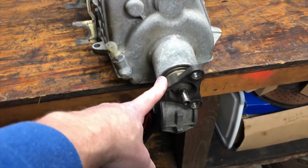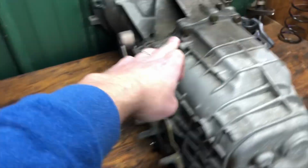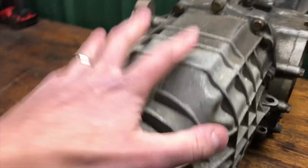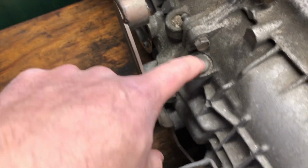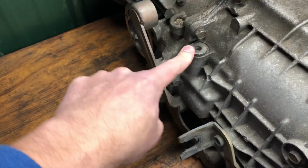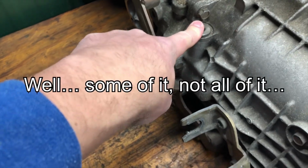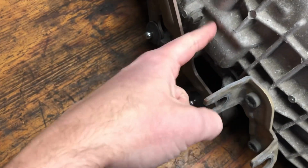So in order to get inside of it, of course, take this flange off, which will be done with a 30mm deep socket. Boom. And then there are a lot of 13mm head bolts up and around this nose cone here to eventually be able to get this nose cone off. Then we will have to take this out, which holds in place a spring and compresses down a pin, which gives you the resistance for when you move this lever. This spring is the actual spring tension that you feel, the resistance that locks the transmission into gear. But I guess because this is a pin, it's on this side of the cone, connecting itself to internals just below here, we need to take that off so that the nose cone can come off.